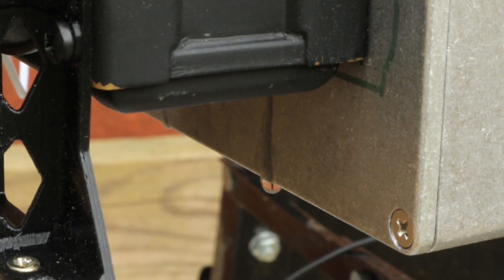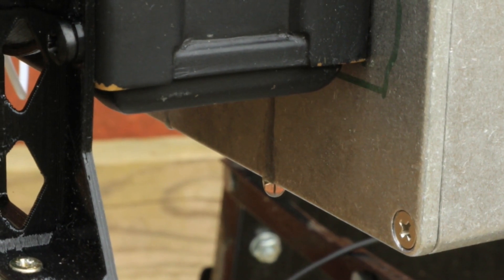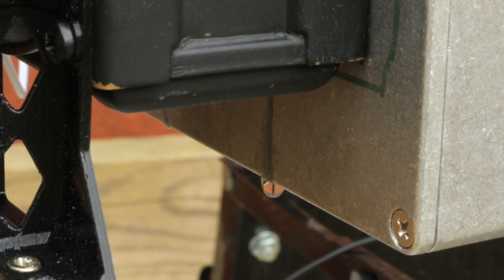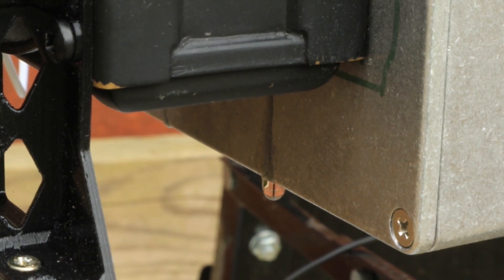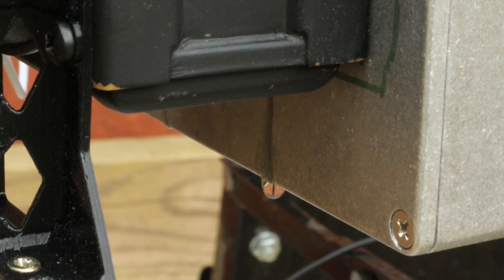What you can see here is as the exhaust gas hits the heat exchanger, because of the difference in temperature, the gas will condense. One of the by-products of burning diesel is water. So what you can see here is water condensing on the heat exchanger, running out of the bottom of the box and onto the floor. It's quite harmless because at this point it is condensed, so it's typically 30 or 40 degrees. But this will form a puddle of water underneath your van if you choose this method.